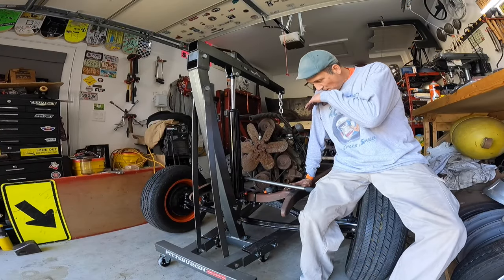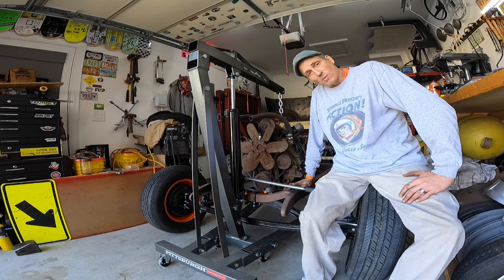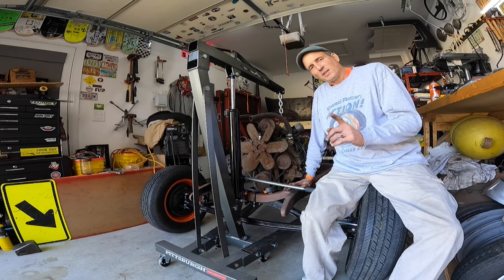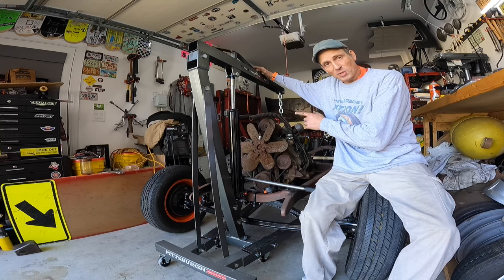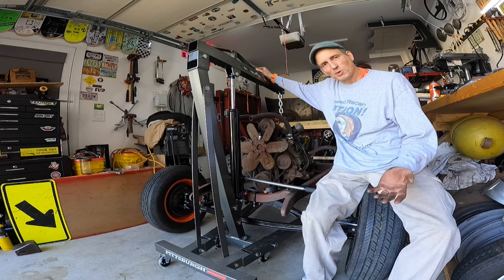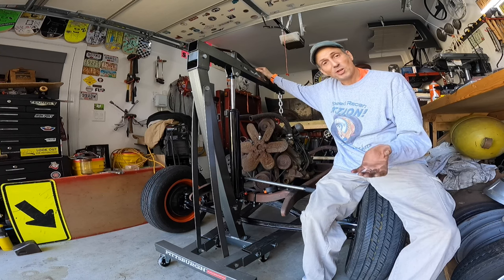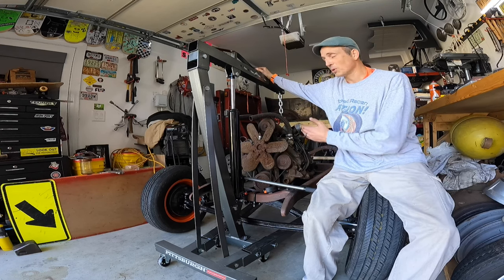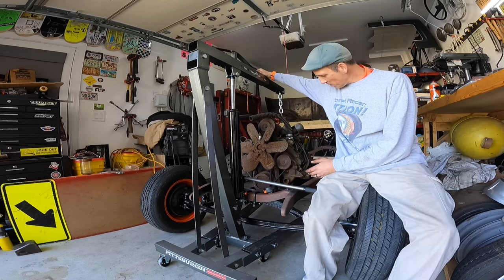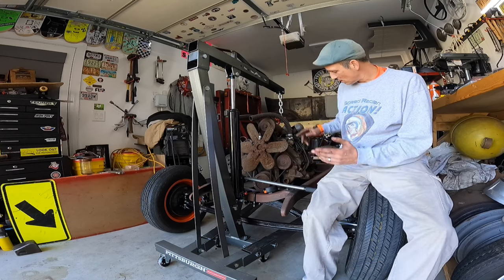Okay so I learned a lot there. Number one, the frame does not roll backwards very well without a tie rod - that was miserable. Number two, I need to learn to do basic math better because I should have had my hoist on the half-ton setting. I had it on the three-quarter ton thinking this was 750 pounds, and totally forgot that a ton is two thousand pounds, so I could have put this on a half-ton and it would still have been fine - that way I had more distance. I don't know if you can see it in the time lapse, but I let the engine down really hard and it caught on the cross member on the pulley. I hope I didn't damage anything.